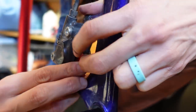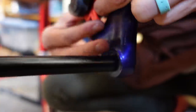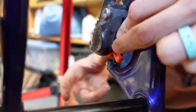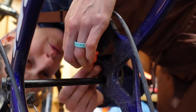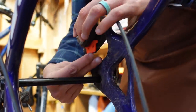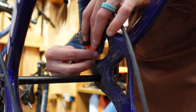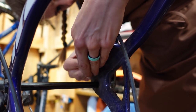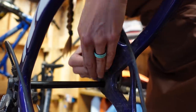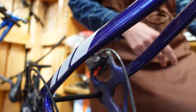We're going to put in our brake shims before we get too far ahead of ourselves. If you pull your brake lever while you do not have a brake rotor in there, the pistons go out and don't come back — it's not good. It requires resetting and it's a pain, and it's very easy for brake levers to get pulled in transit. So shims are a must. They're also pretty cheap. If you don't have brake shims, you can just use a piece of cardboard, but if you're traveling with your bike, you should just get some brake shims.